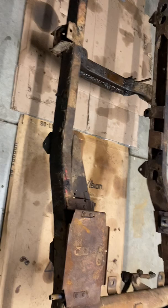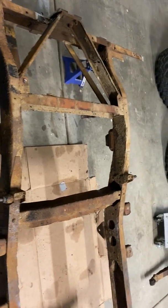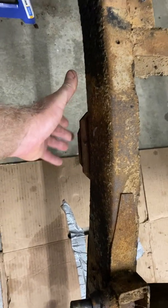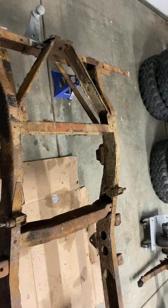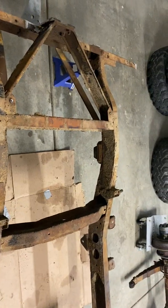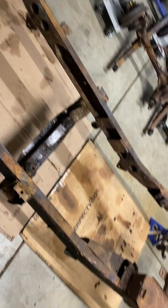But I think if we can get it wired down pretty good and get all of that bed liner stuff off of there, then we'll flip it over, do the other side, the underneath, take a look at those little rubber, what are those called? Those bumpers. And take a look at those, see if they're still good. Might need to replace. They just unbolt, right? There's 1 bolt in the front and 1 in the rear on each one of them. So they'll come off real easy,